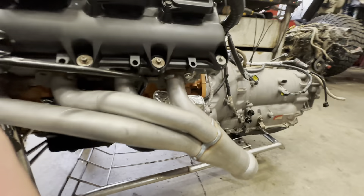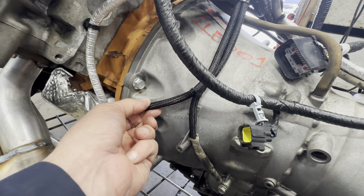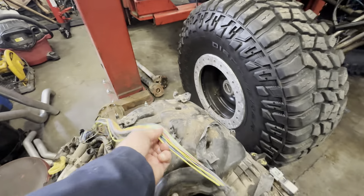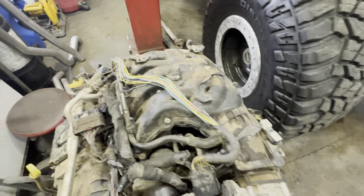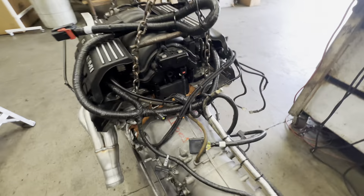Here is the wire to the starter that comes from our harness. The battery cable hooks to the top connector, not the bottom. Here are the battery cables from the Jeep JK that we reuse — there's the ground, there's the power. Here's the old 3.6 liter — we had to cut the battery cables out because they're made inside the harness to the Jeep. We always reuse the battery cables; you've got to cut them out, then wrap them up and clean them up.